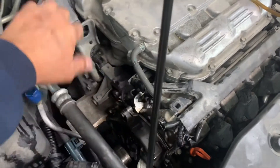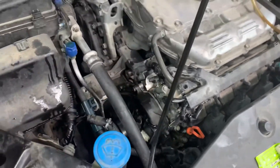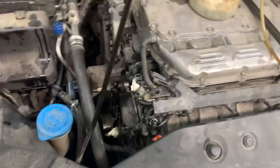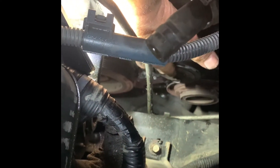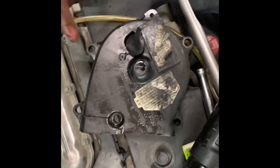You've got these timing belt covers — one there and one here — held on by a bunch of screws. There's like five screws holding this cover on over the cam gears, they're 10 millimeter heads, so use a quarter inch 10 millimeter deep socket to remove them. Before you remove this cover you have to remove the tensioner — at least loosen it up and get it out of the way. That bolt right there is a 17 millimeter — take it out and the whole tensioner drops off to the side.